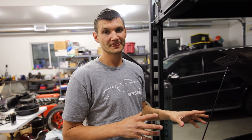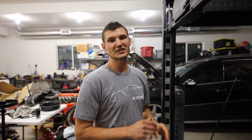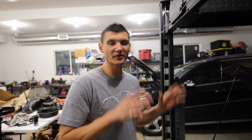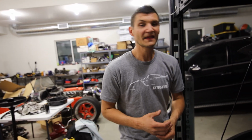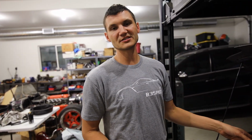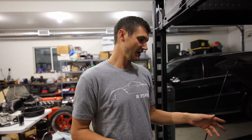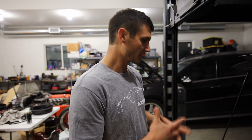I would say, and yes, I've tuned 3/4 strokers as well, that a VVTi head feels very much like a 3/4 stroker. So if somebody says, I've already got a built bottom end, so I don't want to fork out a bunch of money to do a different build to have the 3/4 stroker, I would definitely say, then switch to a VVTi head. You can keep your built bottom end, and you'll get so much drivability. It really does feel like a very, very big, torquey inline six.